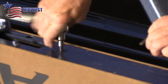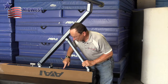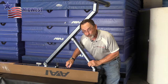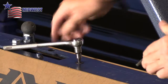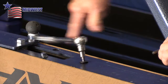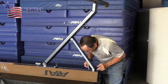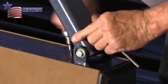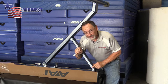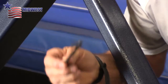Now I'll loosen up these front bolts — these two front bolts you can loosen up all the way until you hear or feel the bolt come loose, and then pull the bolt all the way out. I'll keep spinning and loosening until the bolt comes all the way loose. For the back one, sometimes it's tough to get a socket into position, so I'll also show you how to use the regular Allen wrench — a 7/32nd again.